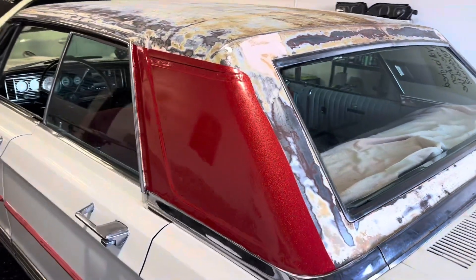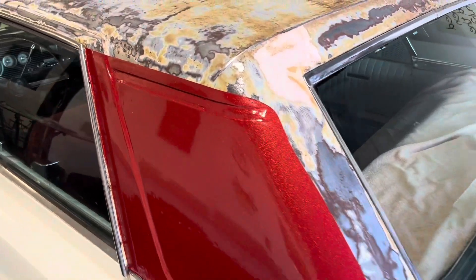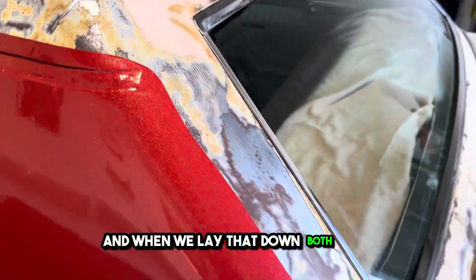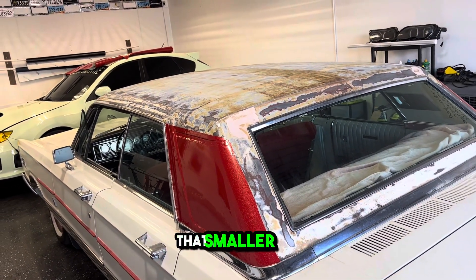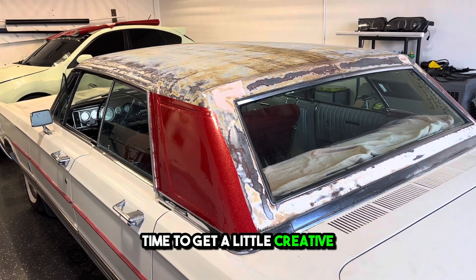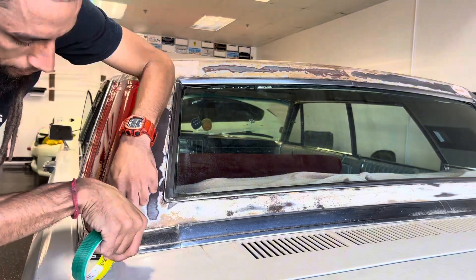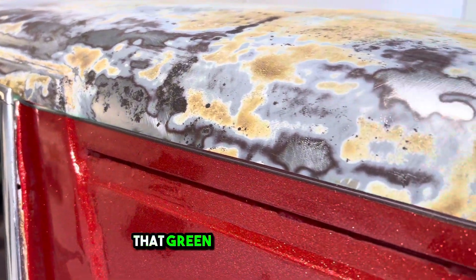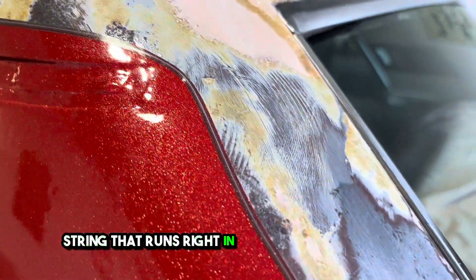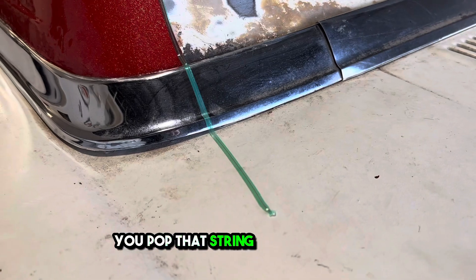First things first, as you can see, the back corner's done. We've got to lay down film on the top. The way we're going to do that is lay down knifeless tape here on this seam. When we lay that down on both sides, we will then lay the big piece down on top, and that's how we will cut that big top piece around the smaller one. We got the knifeless on there — that green line has a pink string running right in between the green tape. When you add the film and pop that string out from one end, that is what cuts a clean, smooth line.